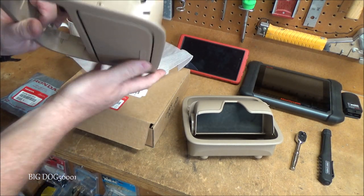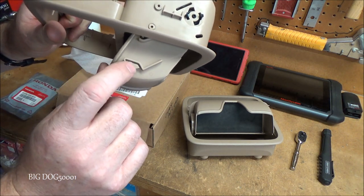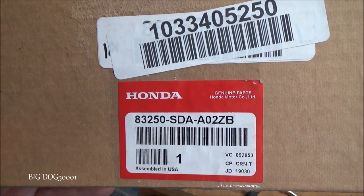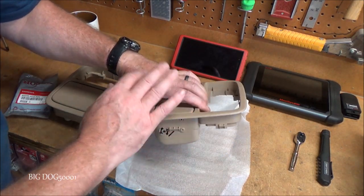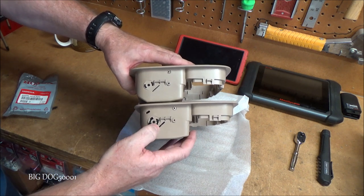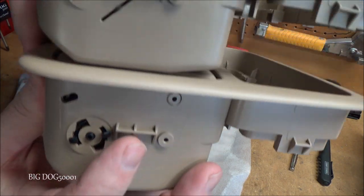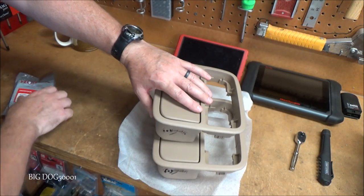Here's the genuine Honda replacement part. You can see how flush it sits and the plastic looks perfect - it works perfectly. Comparing both parts side by side, the real reason I bought the whole unit is here: on the new one there are elongated holes where the cam mechanisms are, and the tangs are much beefier. On the old one the tangs are much smaller and thinner - that's the weak part that was breaking.